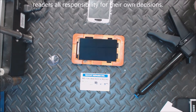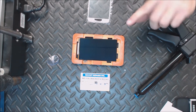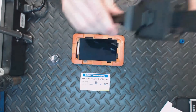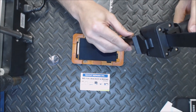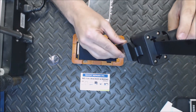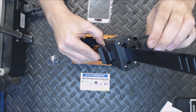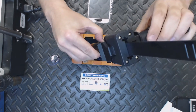On this next video I'm going to show you how to put the LOCA down and then we'll use the UV light to cure it. I've already cleaned the screen and now I'm gonna put the LOCA down on the glass and then we'll proceed from there. I put it in a double-Y format — you'll see different methods out there, but I just feel this is one that works best for me.